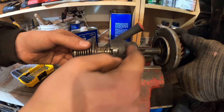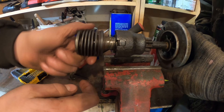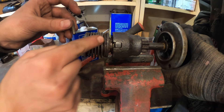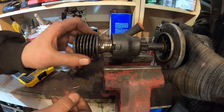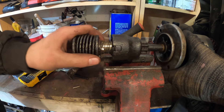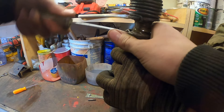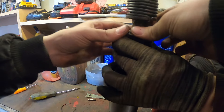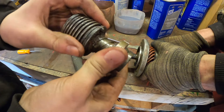This gear and this part are supposed to spin free on this shaft, but now since we took this pin out — which is supposed to hold this spring assembly to the shaft so that this won't spin — this is spinning and this is rusted to the shaft.